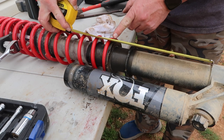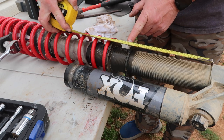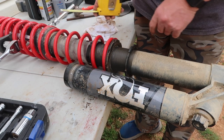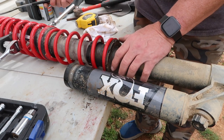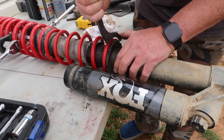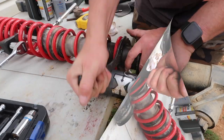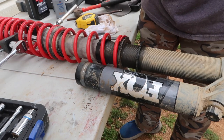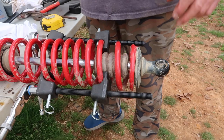On my other spring I found out what works best for my machine is right here from this collar: I measured 8 inches to the top of the spring. My other one was 10 — the original. So I'm going to bring this up to 8 for the top of my spring to be right there, and then adjust my crossover ring. Once I've got the tension off the spring it's pretty easy to turn with the spanner wrench, and once it gets loose I can just spin it by hand. I'm putting a little oil on it to help it turn easier.